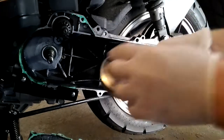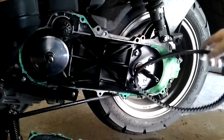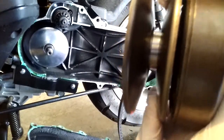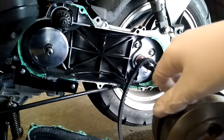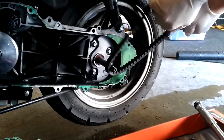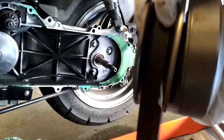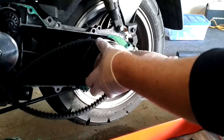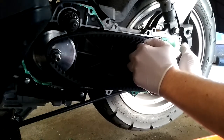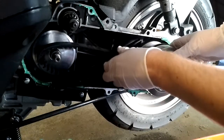It's reassembling time. Good old variator — you just pop it up here like this. The belt part can sometimes be tricky. Put it on the rear axle like this. The idea is you want to get that belt right there in the middle, then open it and stuff that belt so that you keep this open — that way it'll give you room to work around with. Now that's in there. Plug this back on the axle. You see how this can easily go over? You want it even a little bit more so you can squeeze a bit more. That's how those people on YouTube do it — they get all that extra room for the belt.